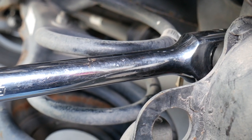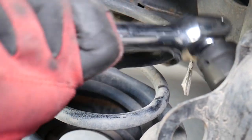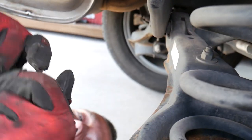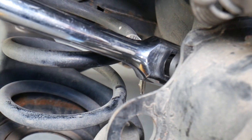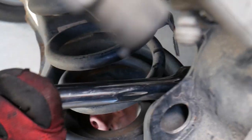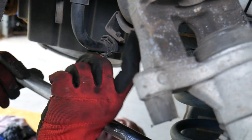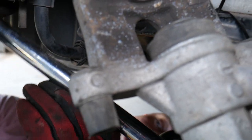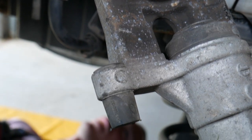Using different socket sizing without much extension, this one came loose as well. I need to turn the socket a quarter revolution so it can fit through the spring hole — and this one is loose too. The bottom bolt is a little more challenging but it did come loose. Be careful not to hit the EVAP system pipe — those are plastic and easy to crack.